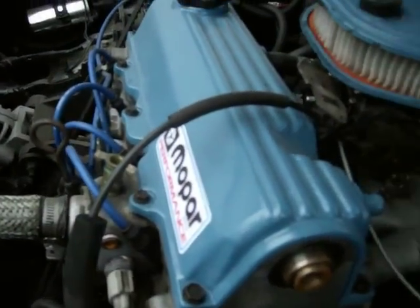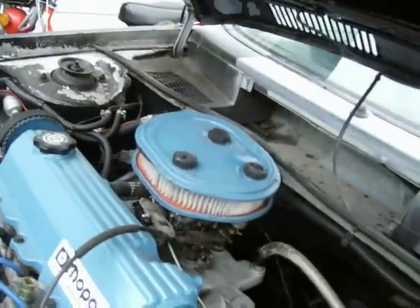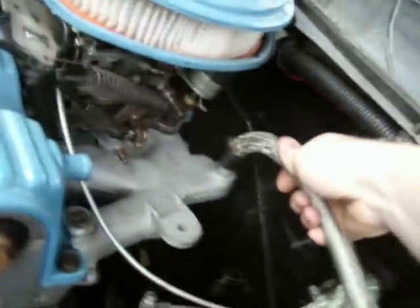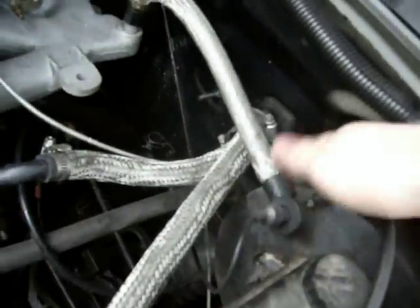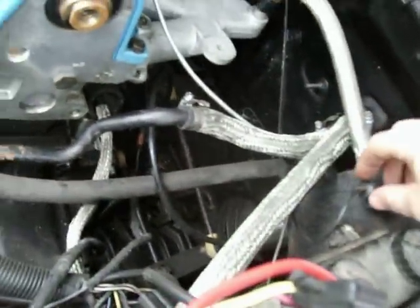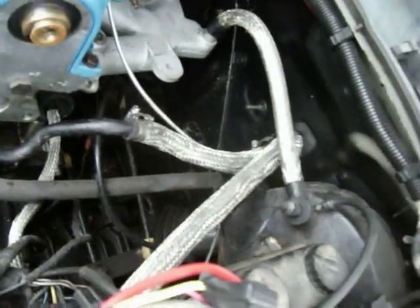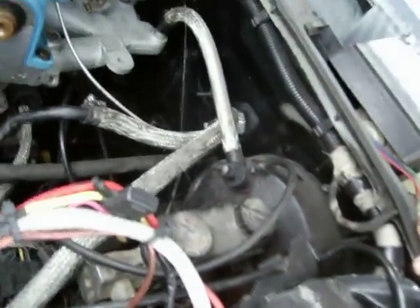I pretty much removed most all the vacuum lines on this car. The only real vacuum line you really need is the one that runs from a main nipple on the back of the carburetor or intake — it varied by year — that goes and supplies power to your vacuum brake booster. Another vacuum line, sometimes two, supplies the source to change the doors inside the car, going from defrost to vents to floor. Those are all vacuum actuated.